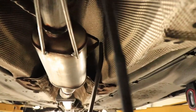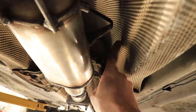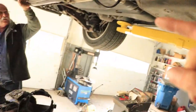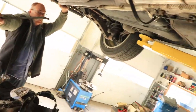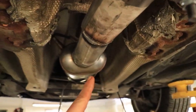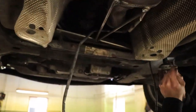We got this bad boy sitting pretty. An issue we were having is the oxygen sensor was actually touching the heat shield on the wall when we went to clamp everything together. We used a pry bar against the driveshaft — just enough to move the pipe over so that when we tightened up the clamp, it moved the whole exhaust over where we wanted it, and now it's clearing the oxygen sensor. We are home free. This is pretty much a done deal other than the insulator and the strap. And I've got a surprise for you guys.